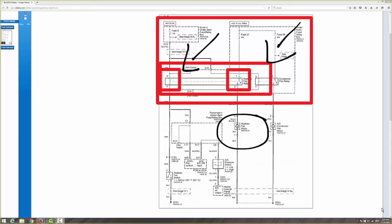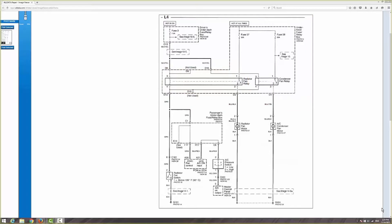Turn the fan motor on. As you can see, first of all I like to find the fuse to the relay. You can see we have two fuses — 57 and fuse 3. Here's 57 and here's fuse 3. Fuse 57 goes to the switch and fuse 3 goes to the coil and the relay. We are going to concentrate on that side first. If we follow this fuse or the voltage down through the circuit, we can see it goes from fuse 3 through the relay coil, out through the relay, and down to the switch.